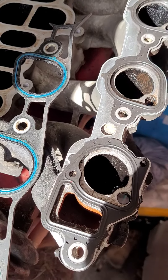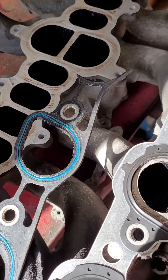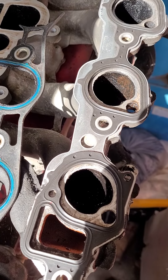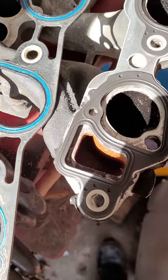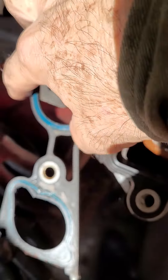Hi everybody from YouTube, this is the second video for the F-250 5.4 Super Duty — the one that has water on the plugs, antifreeze on the cooler, on the plugs. The gaskets on the intake manifold were cracked right here. See the gasket? This is the old gasket — it's based on a plastic frame.